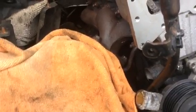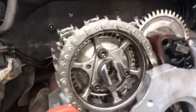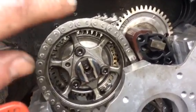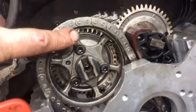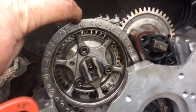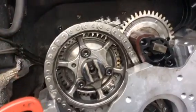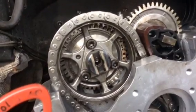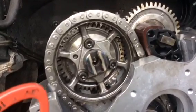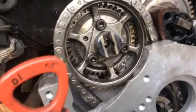Check all your torque settings. I had mine on a piece of paper. I've lost that now. I can't remember what that was, but it is quite crucial to get everything torqued up, especially those stretch bolts. I've not said that actually. When you put the head on this particular model, it's 60 Newton meters, and then you have to crank on a 90-degree turn on each one, and another 90-degree turn on each one, and in a particular sequence.